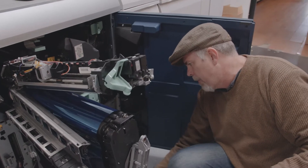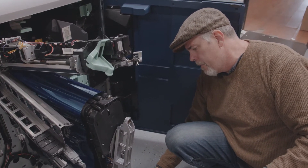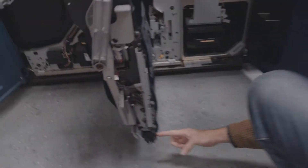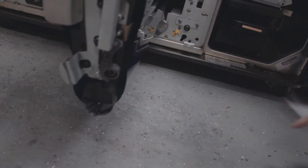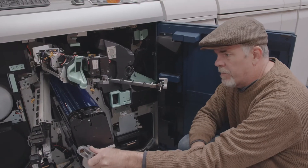Check for it on the tension roll on the bottom and make sure that you're in between the two metal pieces on the outsides of the roll — here and here — and then put tension back on the belt.